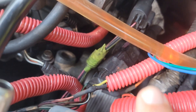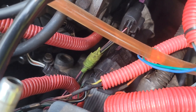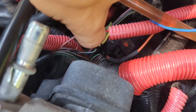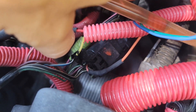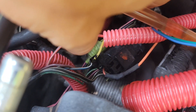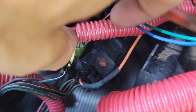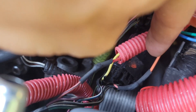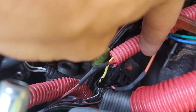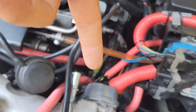The red wire is the ignition coil power in. Underneath it you've got the orange wire, which is the ignition coil power out — orange connects to orange, may have a little stripe on it. Beside it you've got the yellow wire, and that is connected to a dark blue wire with a white stripe.